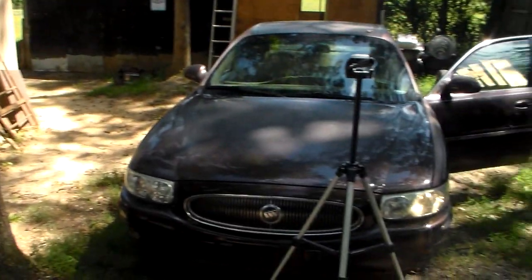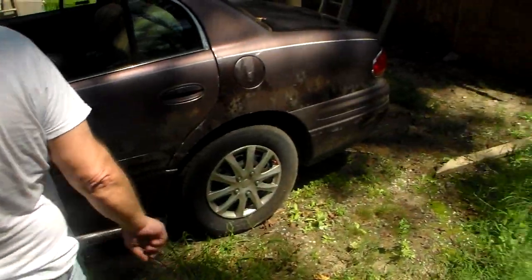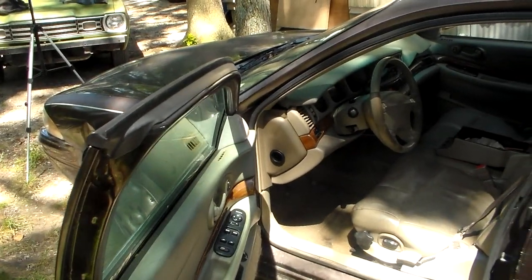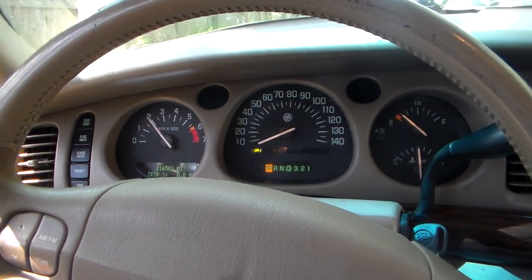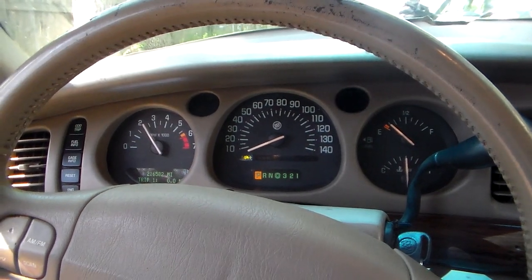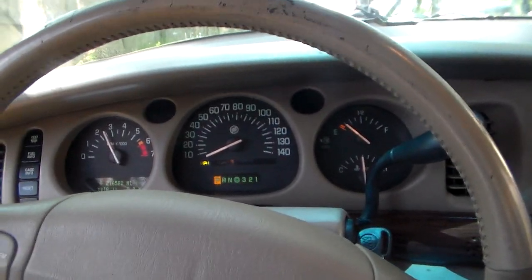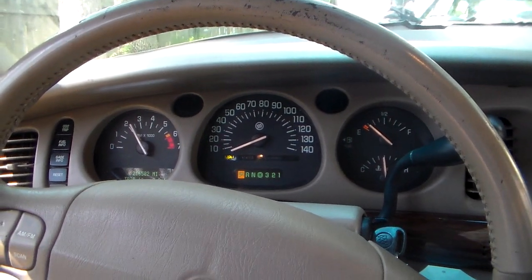We put him on the side of the road twice, but of course, since we're sitting here watching it, it's not done anything wrong, except it doesn't idle very smoothly. We can't tell at this stage if that's something as simple as a vacuum leak, maybe the gasket got twisted under the upper plenum a little bit, or it may have an injector that's acting strange, or the fuel pressure regulator. You may want to take that vacuum hose off later after it cools off. Uh-oh. As soon as we said something, there it went.